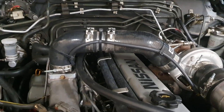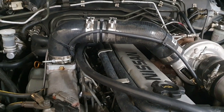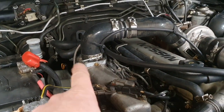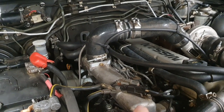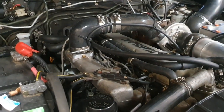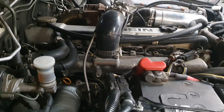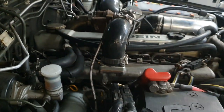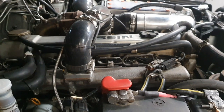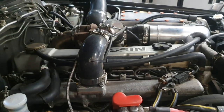We've discussed various different things — making bits, buying bits. Aftermarket kit, like I say, generic. That's on the bench. Inlet manifold — same guys that do all this stuff, Trundles — you can buy a kit or you can send your manifold in and get it done. Basically they chop the top off it and put a different fitting in a different place for your air intake. For what we are doing, it probably won't work out in the right spot. We need this air intake, and it looks like it's going the wrong way — we actually need it the other way. So I'm going to do a custom top, similar to what Trundles make but different. We'll use a Wiggins coupling from here and a 90-degree into the intercooler, which is on the bench.